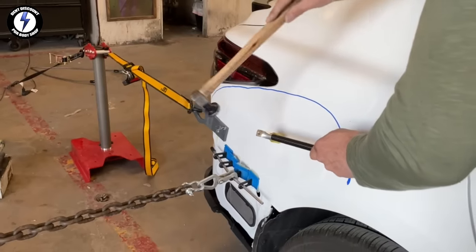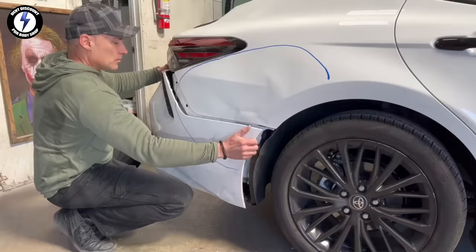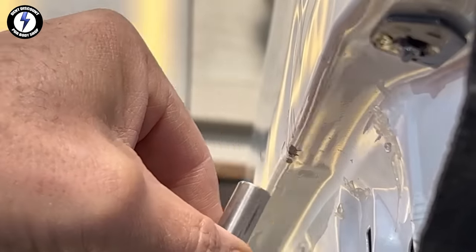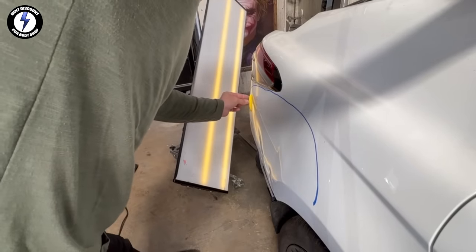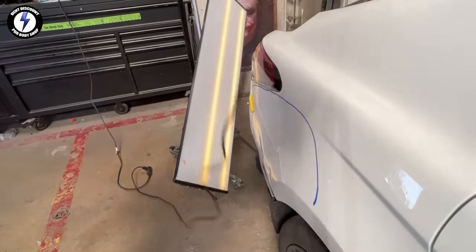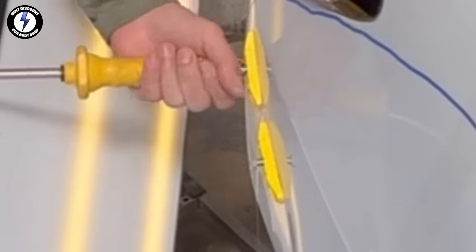After a few minutes of swinging the hammers, time to put them down. I'm going to slide on the bumper cover just for a minute to check the alignment. I had a great, successful first pull. You can now see the crack in the paint from the impact. I'm going to begin knocking down the high areas in and around it, and I'm going to place two smaller crease tabs on the panel. I'll make a couple of quick pulls to get some more metal moving.